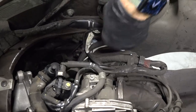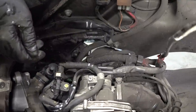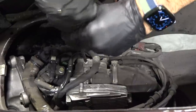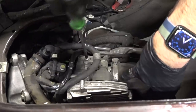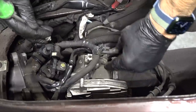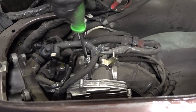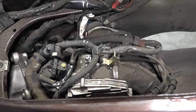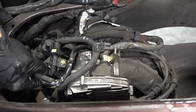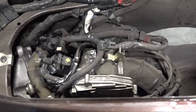Make sure you don't cut into any wiring. Now we can separate some of the wiring. This is your positive terminal for the starter — it has a quick disconnect right from the starter relay. Next, use a Phillips screwdriver for the screw that secures the main wiring to the ECU throttle body and also the fuel line. The GTS 300 has a single fuel line; if you're working on a 250, you'll have a double fuel line system with a return. The fuel injector connection requires extra care.